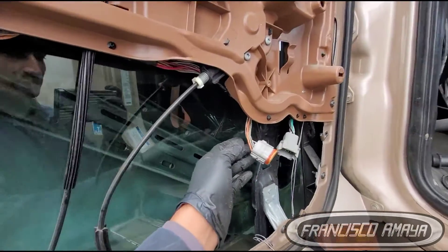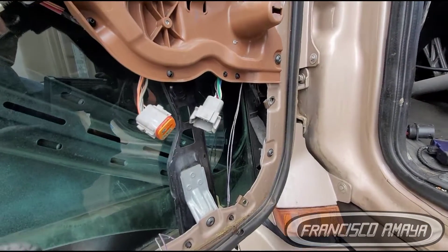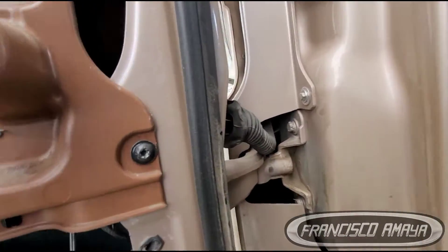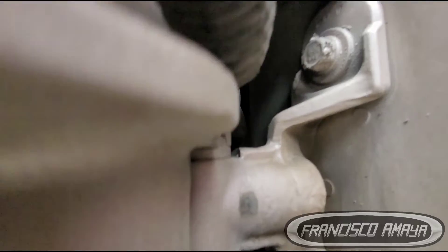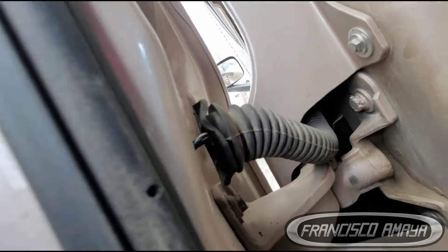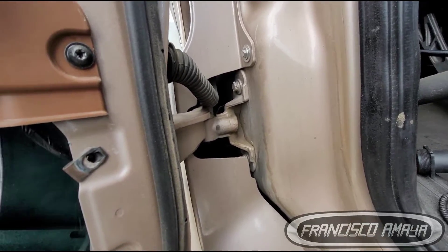The panel has to be removed because this cable goes to the mirror — that's where the sensor is connected. That's the reason why we have this cable completely disconnected, because we're getting problems with shorted to ground and different issues. I decided to open right here just to see — sometimes you're going to get damage in this corner because the wiring will be chafing. But in this case there is no damage here or in there. Usually the cable can be rubbing for so long that the protection material gets completely destroyed and it shorts, but in this case we have no damage. Those are basic inspections — it's just somewhere to start.